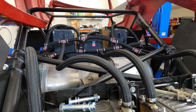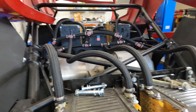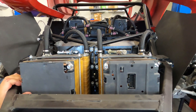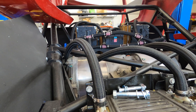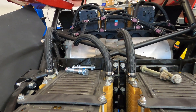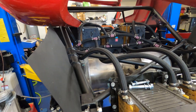There are two sets of Chevy Volt batteries — each set will be wired in series, and then the two sets will be in parallel. I have a wiring diagram for that. There'll be two inputs from the two battery sets into the high voltage box, then one output to the drive unit. Additional outputs will go to the AC compressor, the DC-to-DC converter, a spare, and there'll also be an input for the charger.